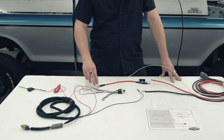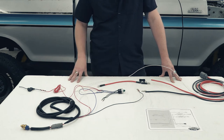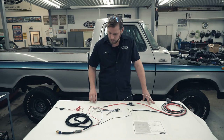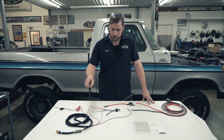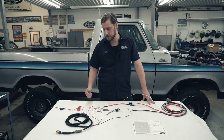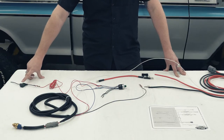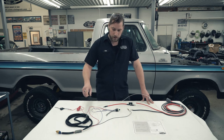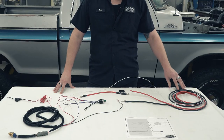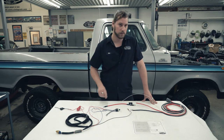The red and the blue are going to run to the blue wires on our trinary switch. We ran this trinary switch, which works in conjunction with our Vintage Air AC unit. Coupled in with the red wire coming from the controller harness, there's going to be a red keyed-on wire that we're running inside the truck to the fuse panel — that's going to be jumped off of the fuse panel. It also has an inline fuse that runs with it just for safety. The white wire from the controller harness is going to be spliced in with the white wire coming from the fan harness. The black wire from the controller harness goes straight to ground, which we ran to the battery.